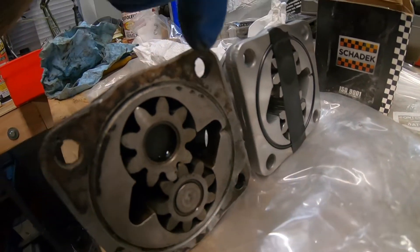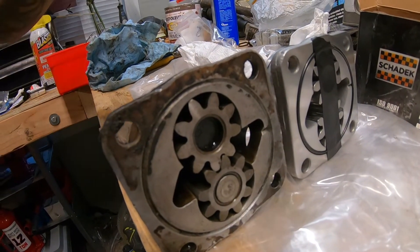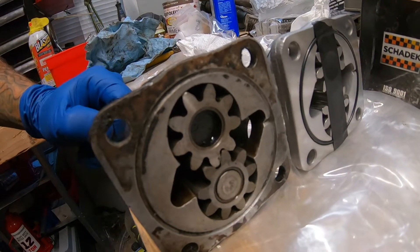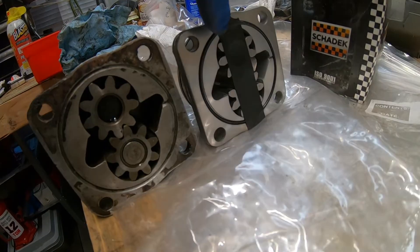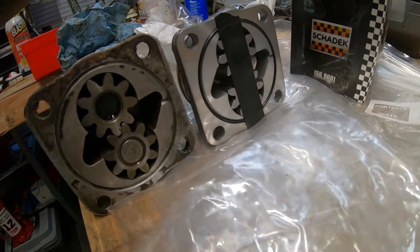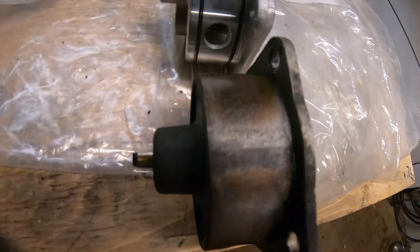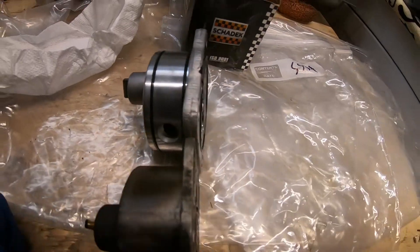On the face there's no oil control. What this is supposed to do factory-wise is if any oil got in here, it would sit in this channel and get pulled in via suction and get pushed through. What Mansi Speed is doing is machining this groove out and fitting an o-ring in there so you get better suction on the actual case and no leaks. The same thing on the back — this is just a machined surface that gets pressed into the block, where we have two oil control rings.